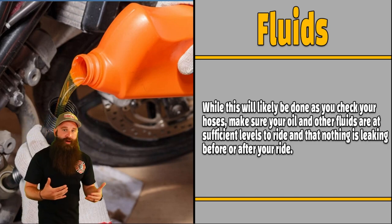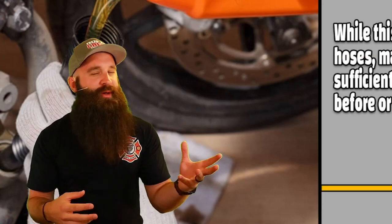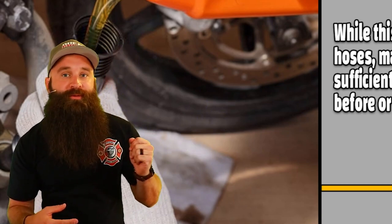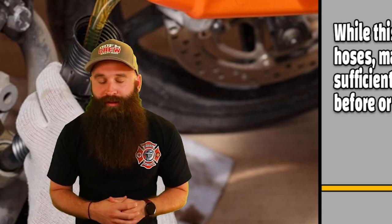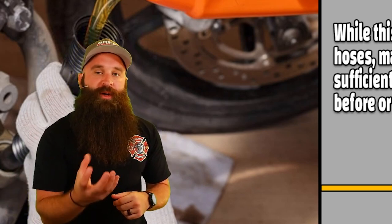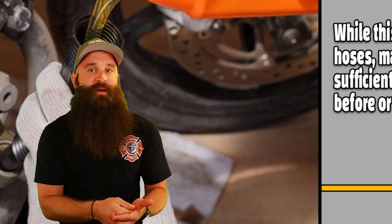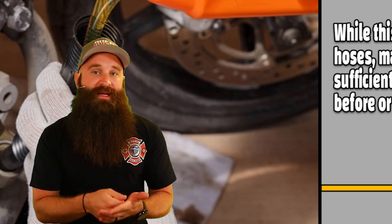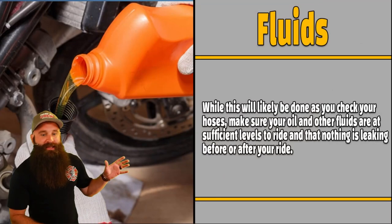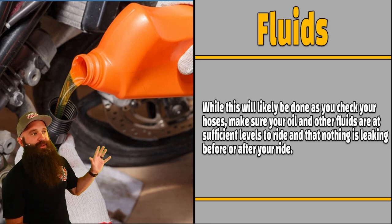Like I said, with the tachometer, odometer, in that section, I like to use the trip meter. Remember, it's trip meter B. Trip meter A is for the other fluid, you know, filling up your bike with gasoline or whatever it is that you use. It might be electric. But the other thing is the oil. So I use trip B and I mark it. This is when I did my oil change. Per my owner's manual, 3,000 miles. So once I see that it's close to 3,000 miles, I do an oil change. And I do it earlier if I see a lot of fluid leaking. If I have an issue, I'll do it earlier, but it gives me an idea of what I need to be doing.